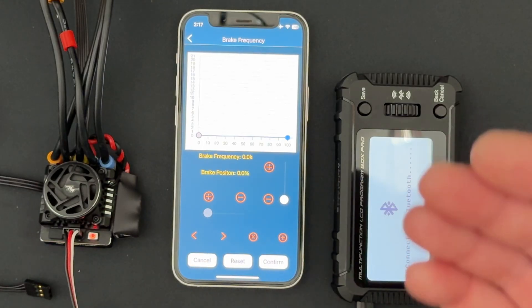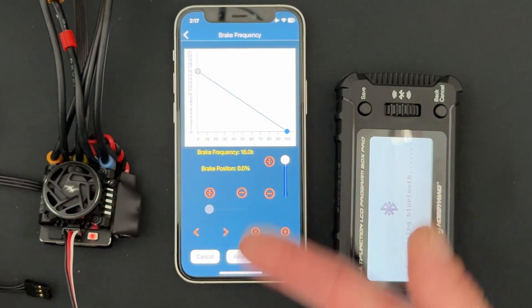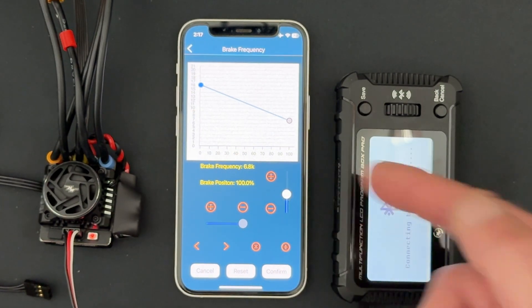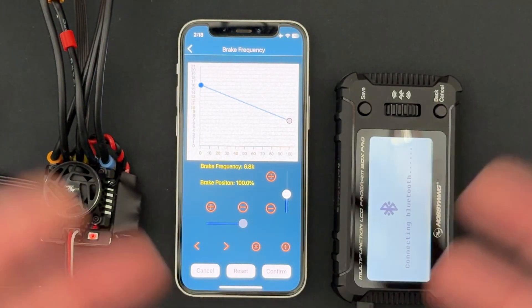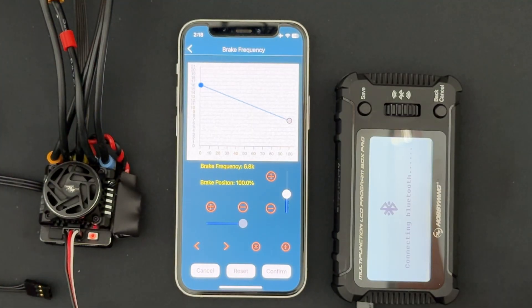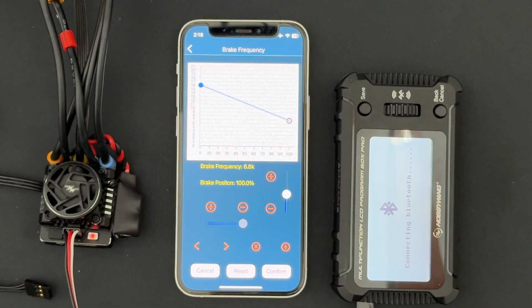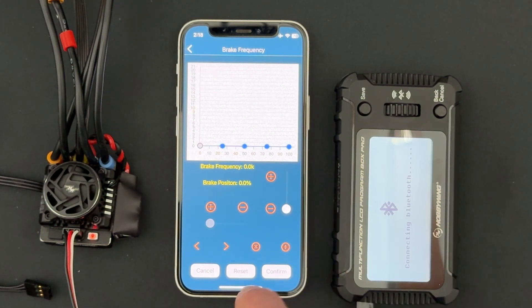On the brake frequency example: a lot of guys running at high speed with quite a bit of traction need the front part of the brakes to be very smooth. So you run something like this — a very high starting frequency dropping to a middle-to-low ending frequency. As you bury into the brakes, the frequency lowers to match the motor speed. The idea behind variable frequencies is to make the frequency go along with motor speed: higher RPMs want a higher frequency, lower RPMs want a lower frequency. In a braking situation, you start with high frequency and end on low, so smooth brakes start at high speed and feed in as you slow down.